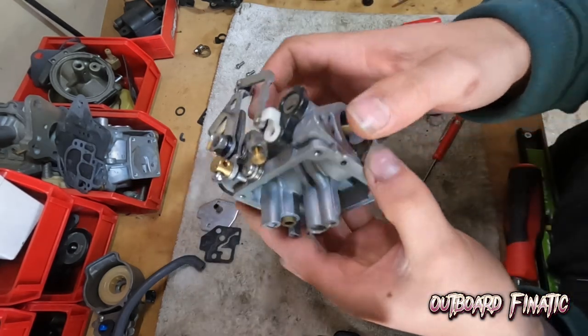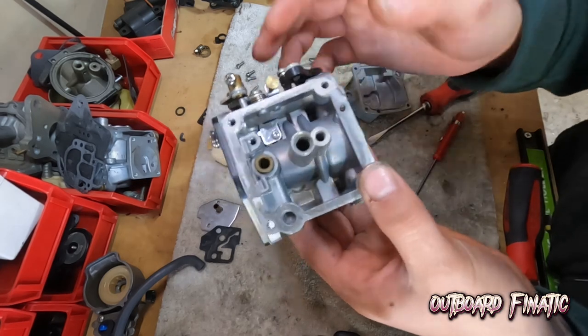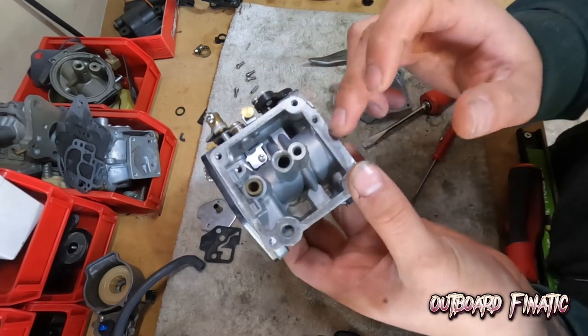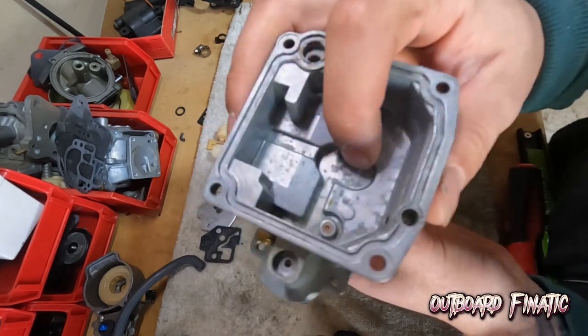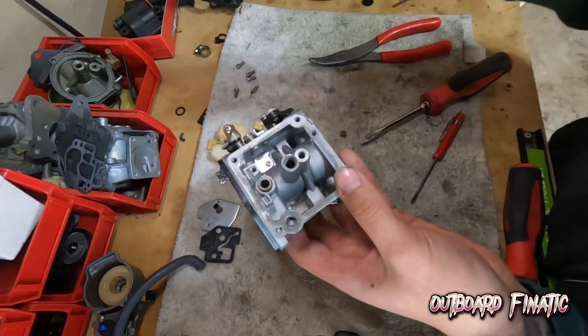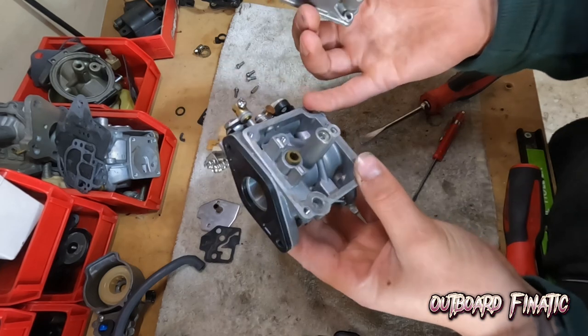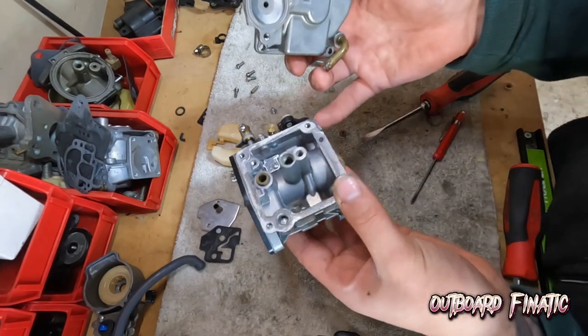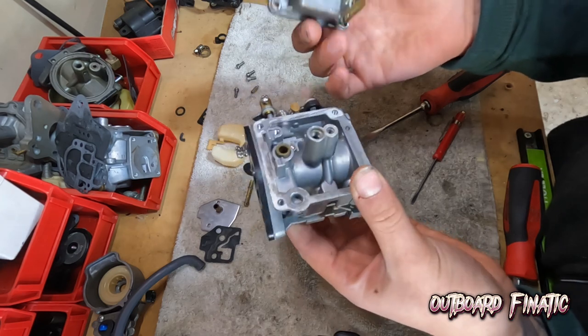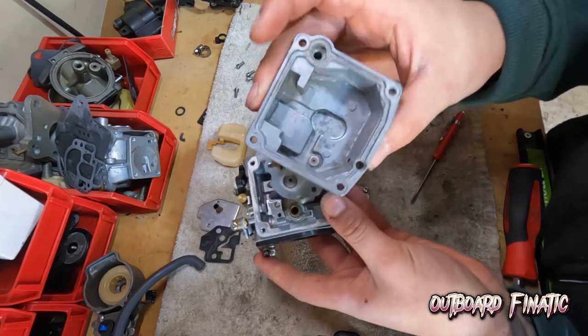So now we fully disassembled the carburetor, and that actually doesn't look too bad other than the bowl gasket was missing. So what I'm going to do is just spray it out really quickly because it does look pretty clean in here, and then I'm just going to reassemble it. I do have a carb kit for it. I'll have it in the description down below, but some of the stuff I'm not going to replace just because it is all pretty much brand new. Let's get it reassembled and back onto the engine.